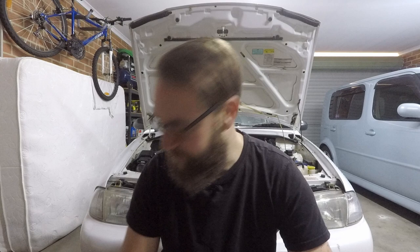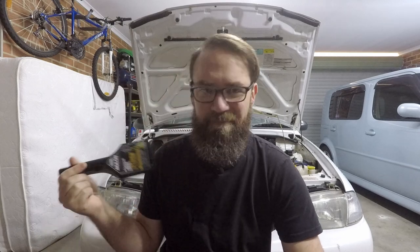I'm going to remove the valve cover just to see what the engine looks like now, and then we'll warm it up for about 10 or 15 minutes and take an oil sample of the current oil. The current oil has done about 1,200 kilometers, which is around 780 miles. Then we'll add the flush fluid — I just picked up whatever was on special.